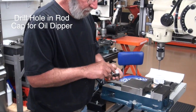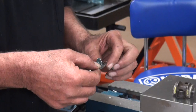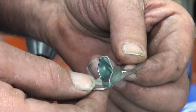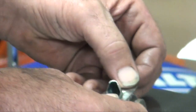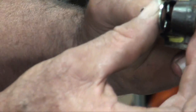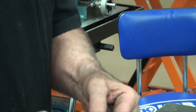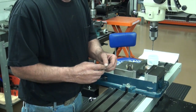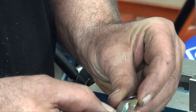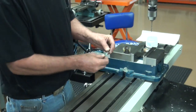The rods were X'd and now we need to drill a hole in there in order for the oil to be picked up by the dipper and help lubricate the rod. Dippers weren't common to Model T's — maybe some of the late '27 engines had some dippers on them, but back in the day I think they used a Chevrolet dipper, found it would work. A lot of times this is just too wide and doesn't fit down in there. I like to just go to the bench grinder and grind a relief in it — the early Chevy ones were relieved out about an eighth of an inch. Just go in here and grind off — don't grind so far that you knock the spot weld off — just clean those up to where it'll fit into that cap better. We'll take our dippers to a grinder and cut them to where they'll seat down on here better.